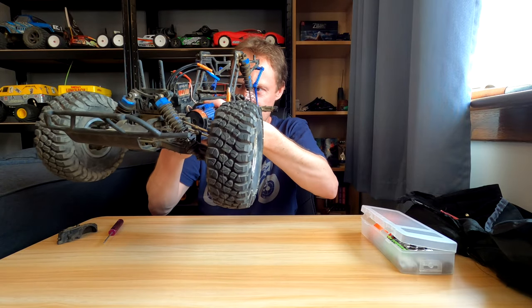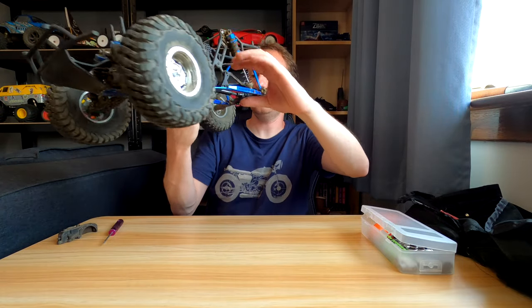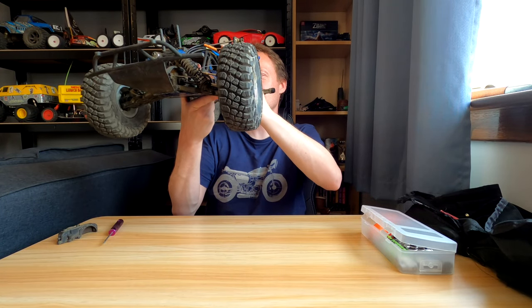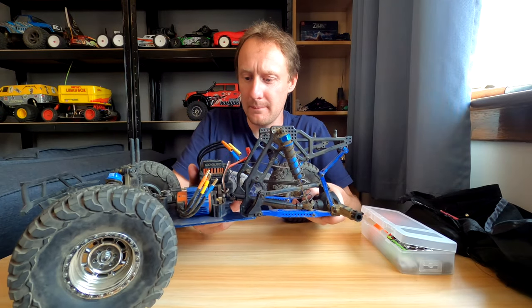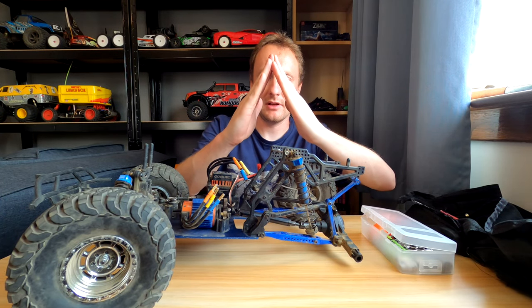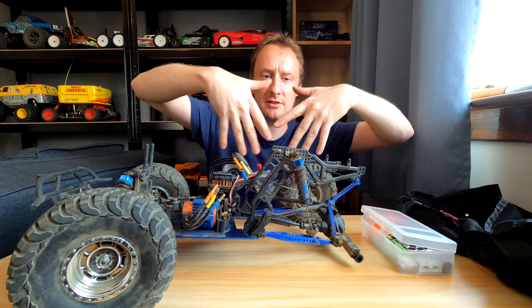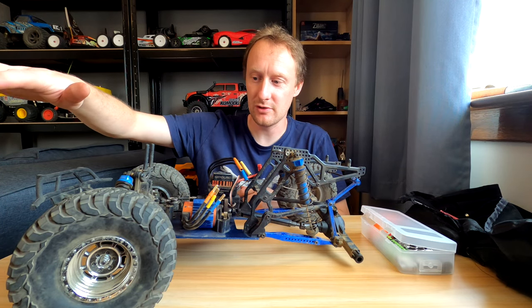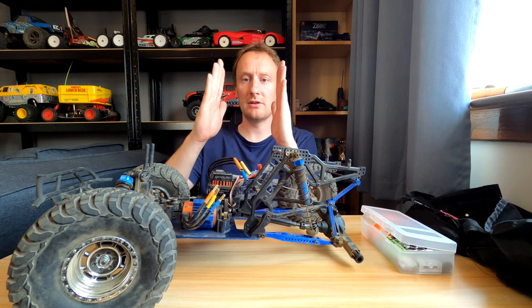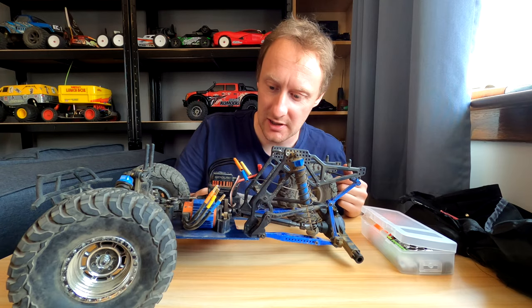And they're still original. The pinion is looking too sharp now. The teeth have sort of shark finned, if you know what I mean. For those who don't know, the pinion is supposed to have gears that are that shape, and over time they sort of bias to one side because it's always running in the same direction, or mostly forward. It's not only that 99% of the use is forward, but also it's got more power forward. So the gears are never even anymore. They're sort of carved away on one side and they kind of resemble shark fins.